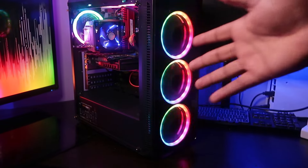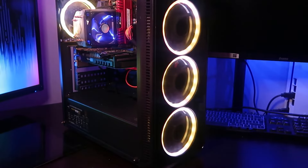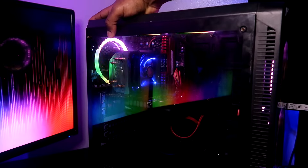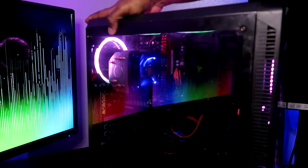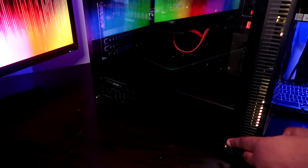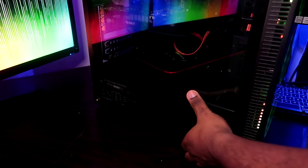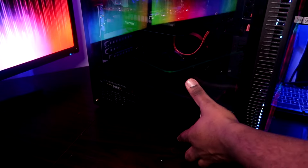As you can hear, this is going pretty loud — if I bring the camera any closer you can hear how loud it is — and that's because I think it's really dusty on those fans. To remove the front panel, usually what you'll do is unscrew the four screws that are here, here, here, and here at the bottom. You want to make sure that you secure the side panel very well because this is glass, and some are plastic.